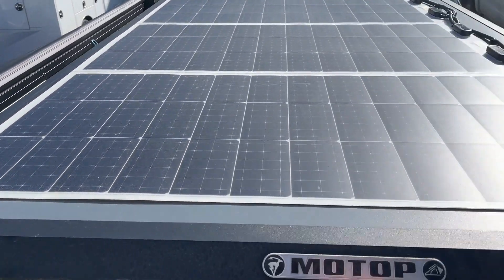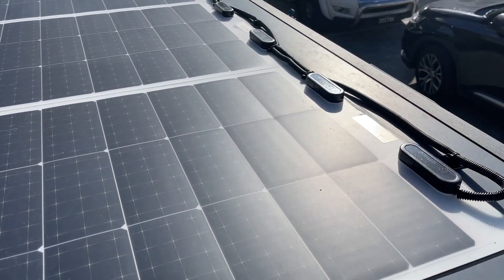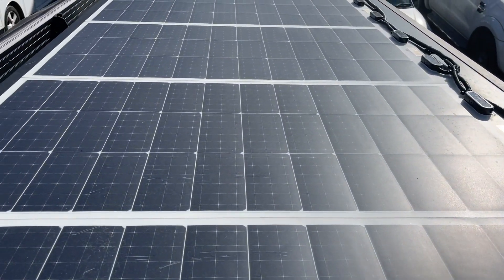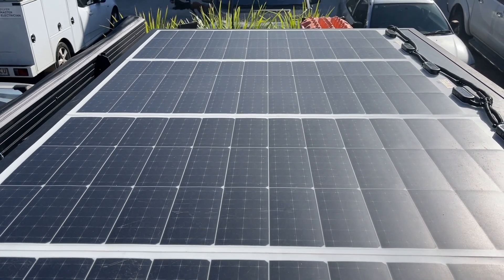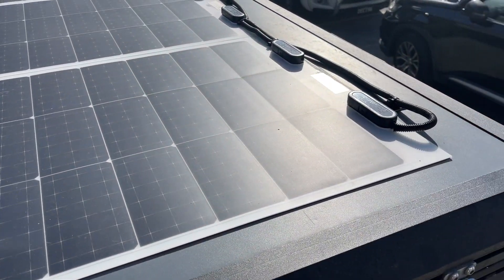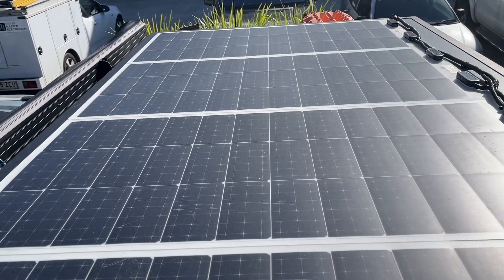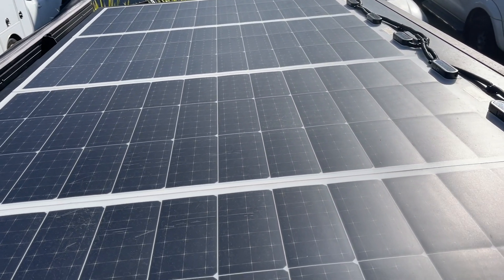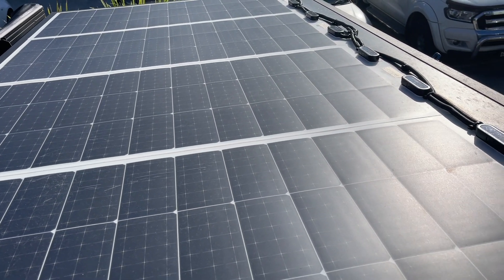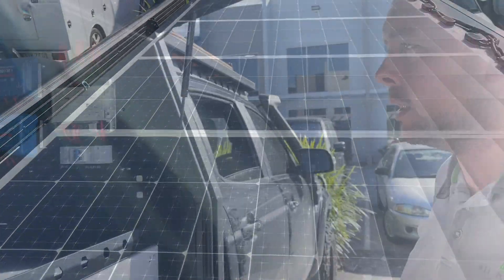On top of the Ranger, there's the Motop, and here's the Copperflex on the top. He's got these two in series and then in parallel. Look at this — four of the 100-watt panels fit absolutely perfectly on the Motop; it's an exact fit. That's 400 watts on top. Each panel is 1.7 kilos, so you're adding a total of 6.8 kilos — very little at all.